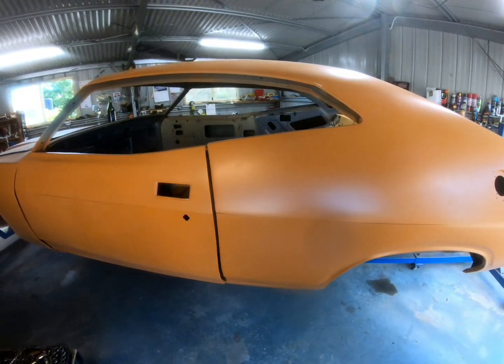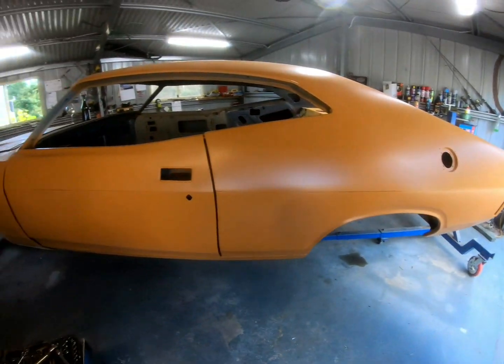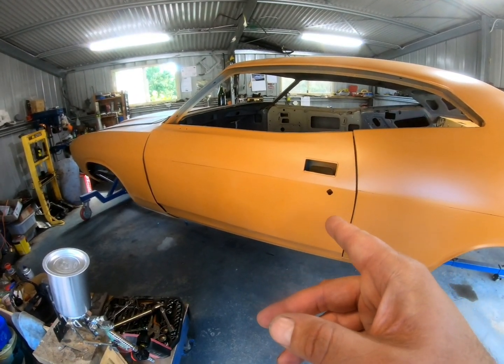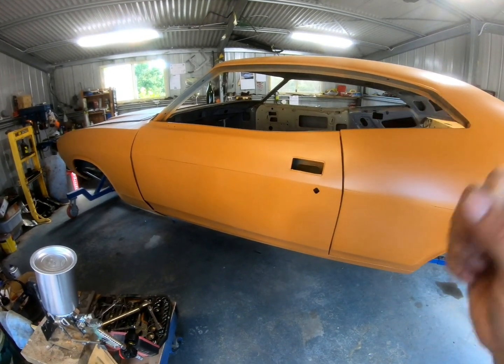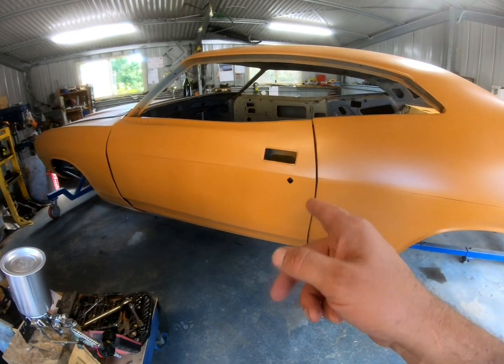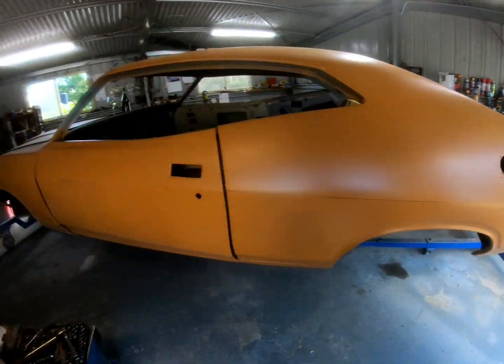I've got that. So I've actually got the speedo cable out of this car, and I've used it in the Escort. It works, same connection on the back of the cluster and the C4 transmission. So this actually runs a C10 where the Escort runs a C4, which is out of a Mustang.